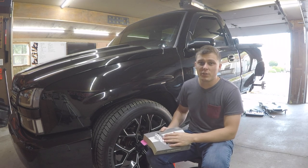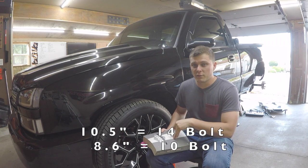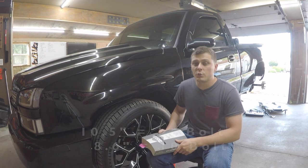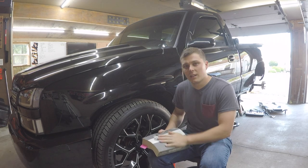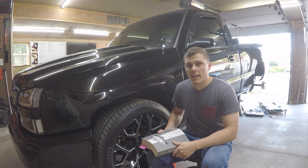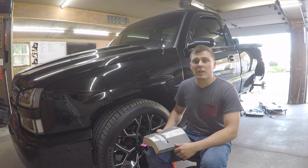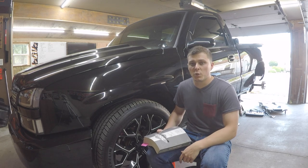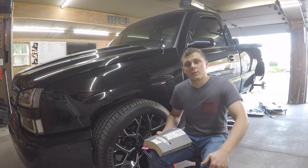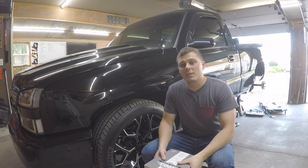When I looked it up in the manual, I was looking under a 10.5-inch differential. In my head I read '10-bolt differential,' but the diff in my truck is an 8.6 — a lot smaller — and those torque specs are drastically different. This was supposed to be a five-hour job. Changing the rear axle bearings put me a week behind, and now snapping that bolt puts me back another day or two. Always have patience and always triple-check yourself.